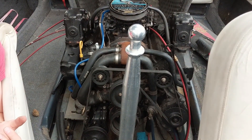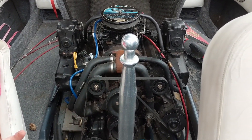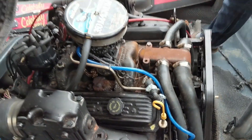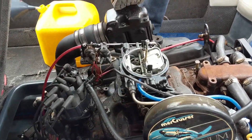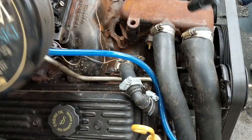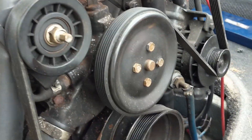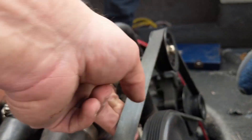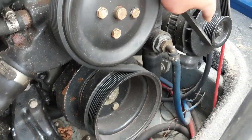The engine made a bad clicking sound. It sounds like the starter is trying to engage but it's not turning the engine over, which tells us the engine may be seized. That click doesn't necessarily mean the engine was seized — sometimes it indicates a starter that's not fully engaging or a relay clicking because of the battery. In our case we felt the starter was fully engaging; the sound was deeper and clunkier, so we knew the starter was engaging with the flywheel.